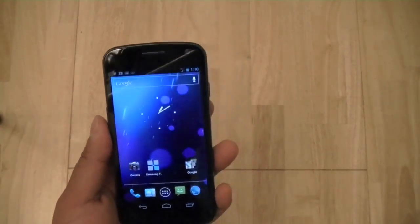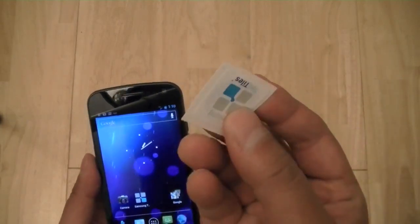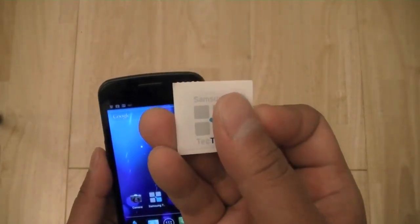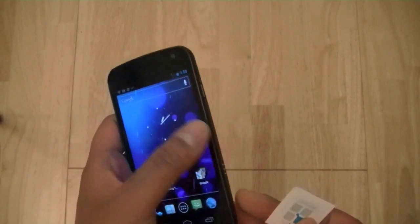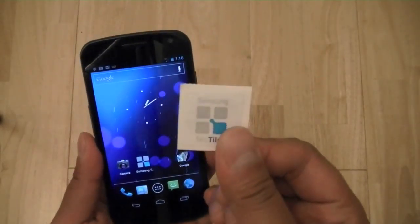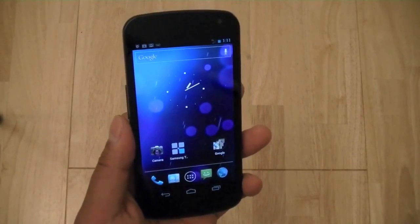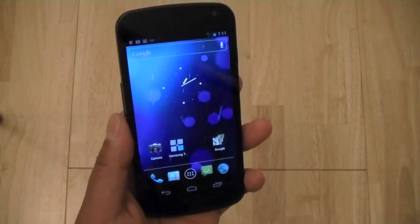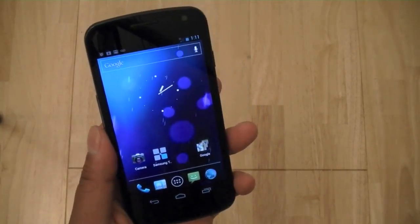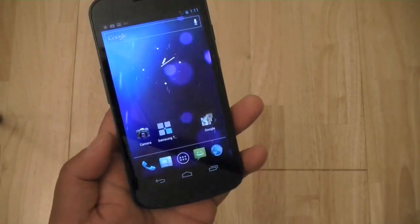Once you get your Tectiles — which are stickers you can place anywhere — these are disposable. They come in packs of 5 for $15. Once you initially tag the Tectile to your phone by placing it to the rear so the NFC on your phone can read the NFC tag on the Tectile, upon initial launch it will ask you to either install the Tectile APK via the browser or go to the Google Play Store and install the application that way.